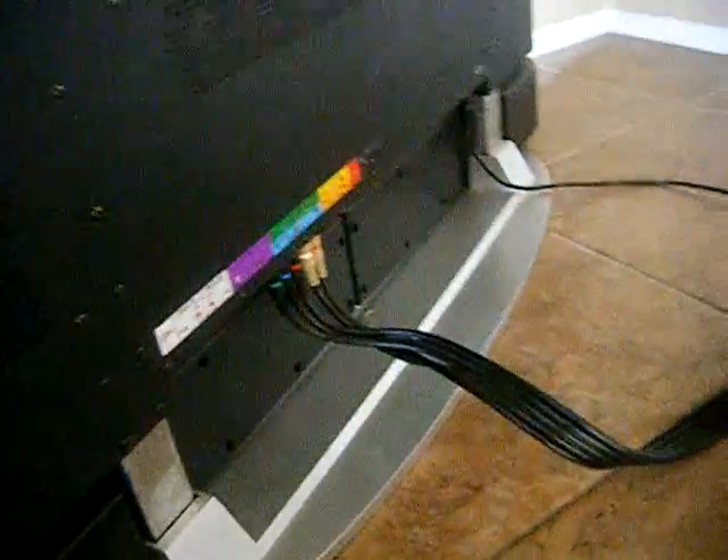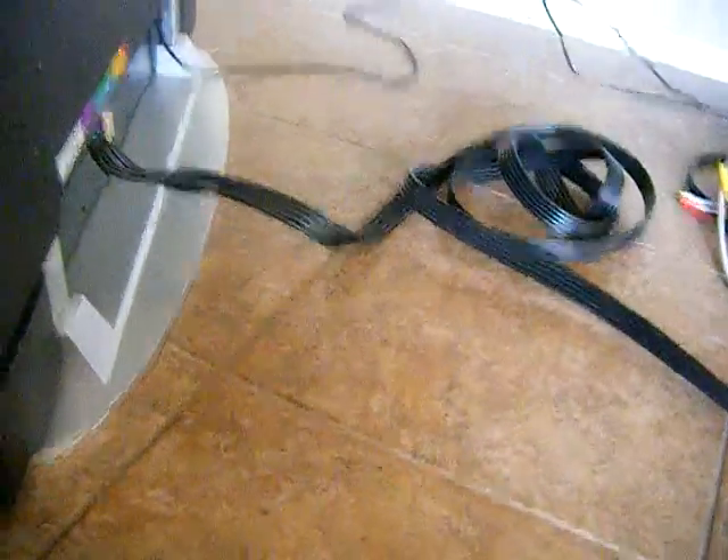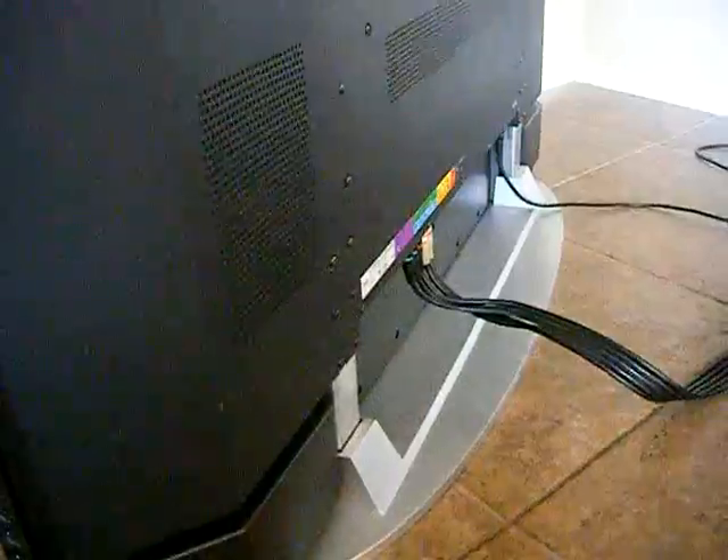Now remember, we went HD1. Usually what happens when people hook up their cable box, they just turn on the TV, get no picture, and panic — they think their TV is bad or the box isn't working. The first thing you need to do is make sure you're on input one, because that's where we hooked up the component cable. We have no signal on HD2 — we didn't hook it up to that. Cycling through inputs... HD1, and we got a picture.